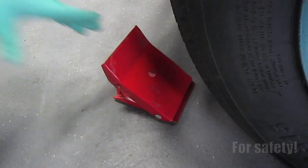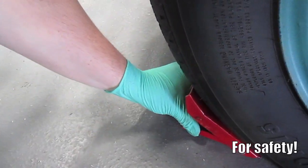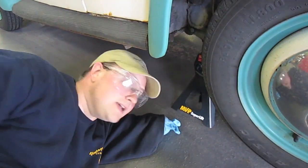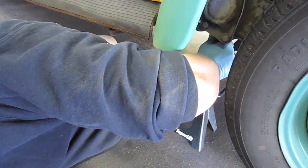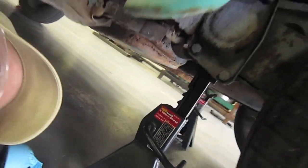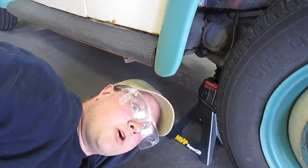When jacking up your car, the car will move a few inches, as you can see here. Don't forget to move your chocks back in to hold the tire. Once your chocks are in place, come back and reset your jack stands. Also, make sure they're directly under the torsion bar.